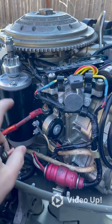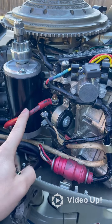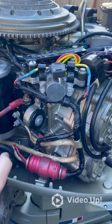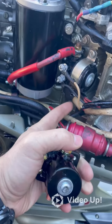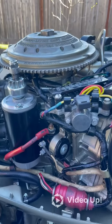If you don't have jumper cables, here's another way: take your positive terminal off the battery so you don't electrocute yourself, then remove this positive wire from the solenoid. Use a pair of pliers or something that's insulated — if it's metal you're not safe. Grab it at one of the insulated parts, then touch that directly to your power supply down here. Move this boot and touch it right there — it'll spark.